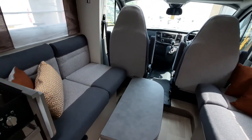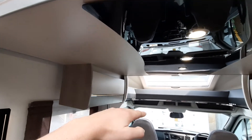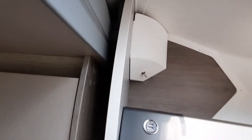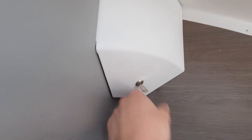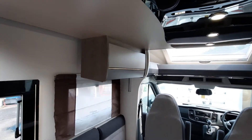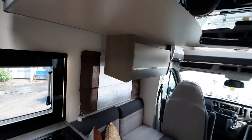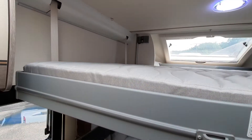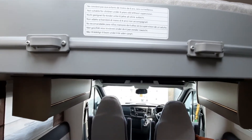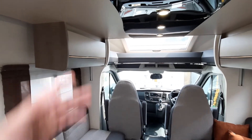At the moment it's in the down position to allow for the bed. To operate the bed, it will go halfway. There's a plastic box in the cab — at the moment we've got the key in. Turn the key to activate the system and that'll activate your bed. Make sure the area is clear before doing so. Come to your kitchen and you'll notice your bed button there — press that and it'll lower the bed. With your bed, you can keep all your bedding on — just stick your pillows at the front and you're good to go. It'll stop automatically once it's up at the top.